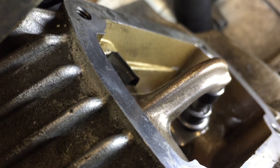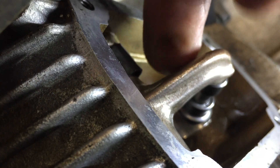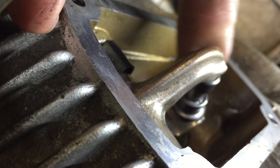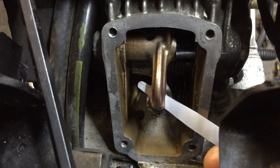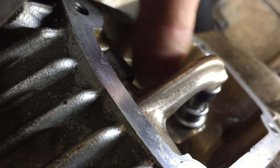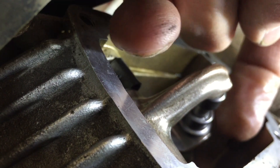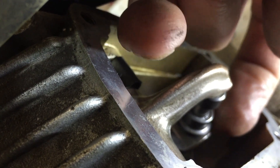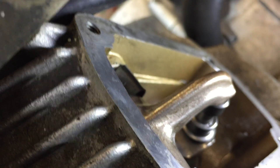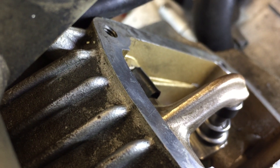So you've got two clearances on each valve: you've got your opening clearance and your closing clearance. So you've got two rocker arms — you've got an opener and a closer. The opener you measure in the usual way, just feel the gauge between the rocker arm and the shim. And then the closer, you need to push it down with a screwdriver against the spring resistance, with your feeler gauge between the fork and the little top hat shim to get your clearance there. Then you measure all those and get all your clearances to work out whether you need to adjust them or not.